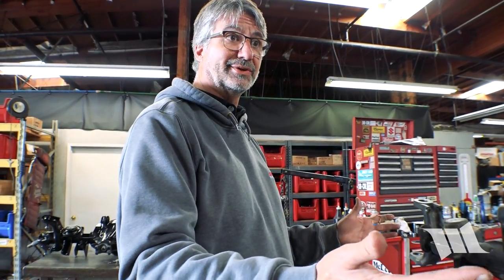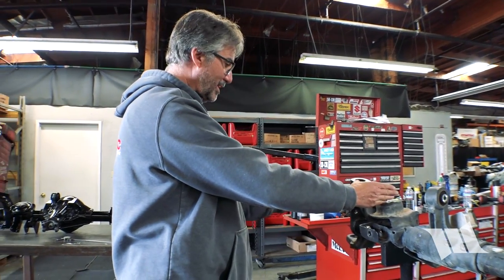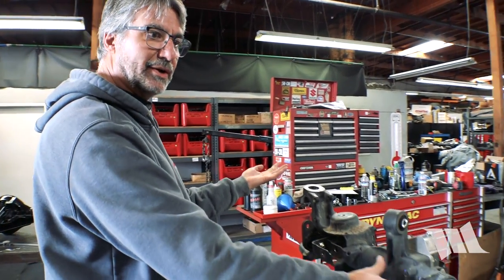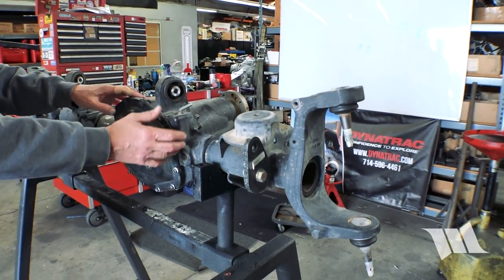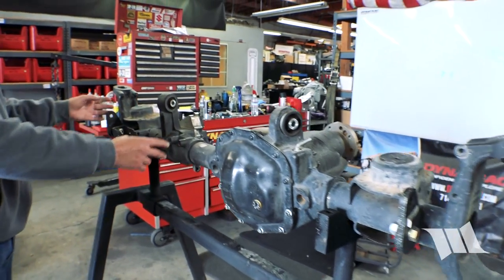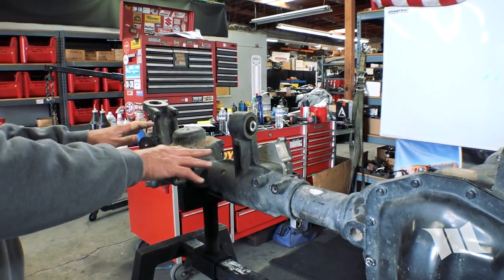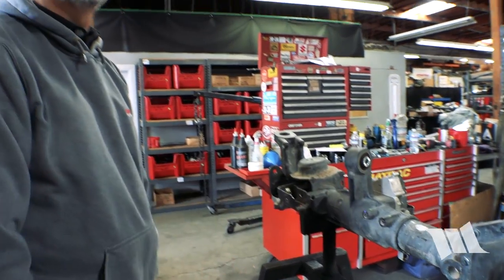Our Pro Rock 60s built for many years were 68 and a half inches, so the JKs got wider and the car's wider — that makes sense. But you have to look at each one of these legs as a little bit of a lever with a fulcrum here. You have a tire out here; as that tire pushes up, it pivots off the fulcrum and tries to bend the housing. On one side, the big casting absorbs a lot of that force, but on the other side there's less material and a longer stretch. So as one side is pushed upward, the other is pushed downward, trying to fold the housing — and that's what's causing some of those failures.